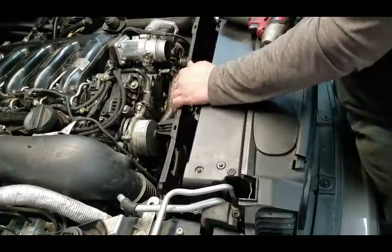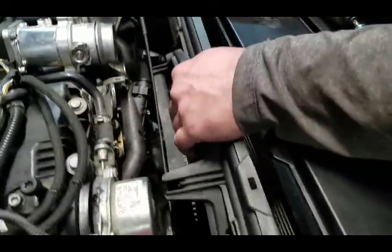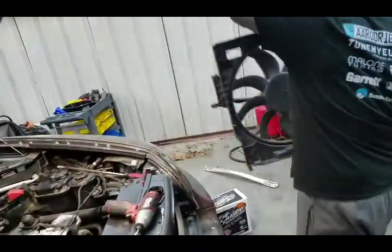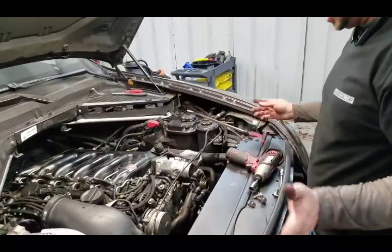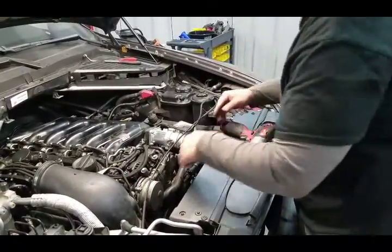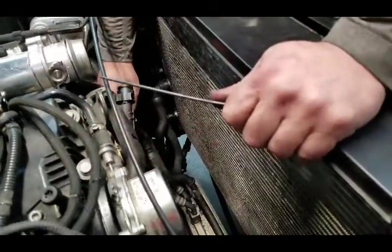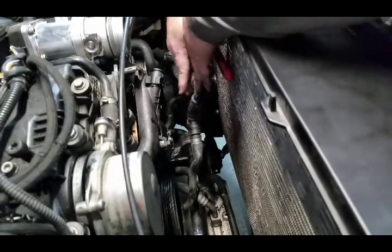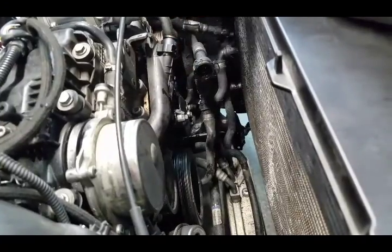There's a hinge on the fan — you're going to want to flip that towards the front so you can get this out. Now at this point the coolant's already been drained since I was changing out the thermostat. I'm going to release this clip on this hose right here — this comes off and then I've got access to the belt pathway. The old belts I'm not reusing, so I just cut them off. Saves five minutes.